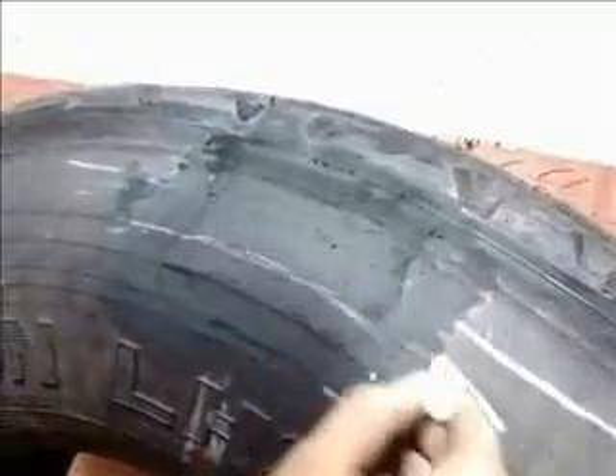Trim off any excess filler, allowing it to be slightly raised at the centre. Insufficient filler stock at this stage will result in sunken patches or porosity after cure. The finished repair should be checked immediately after curing for lifting or separation. Dependent on the equipment used, it may be necessary to grind down or finish buff the outside repair to improve the aspect of the finished tyre. It is recognized that a major repair to the sidewall of a steel radial truck tyre may bulge slightly after processing. Materials and limits should be used to restrict the height of the bulge to no more than four millimetres.